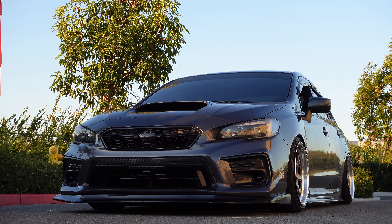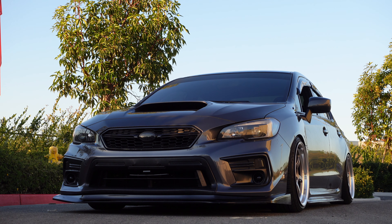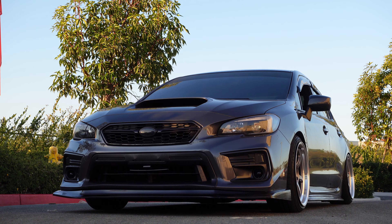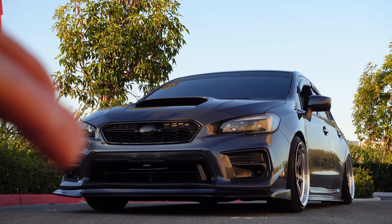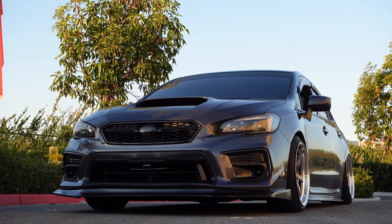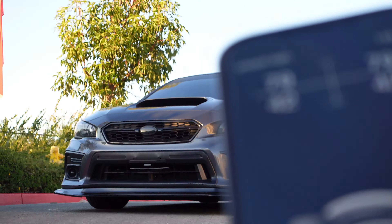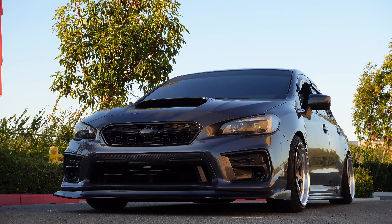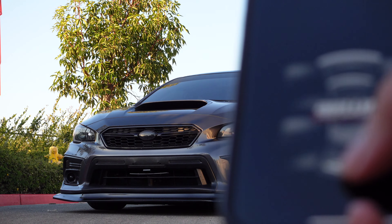The fronts are a little janky but it is my daily ride height, so that explains it. This is what I call my 80/40 — so whenever I go to a drive-through or somewhere with a steep incline, I use the front of my car with this 80/40 setup to prevent breaking my front lip. Then once the front end has cleared whatever I'm avoiding, I hit the all-four lift and it lifts all four corners up. You can go as high as you want — those are the presets I have.